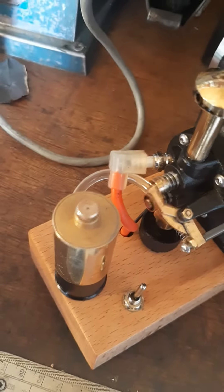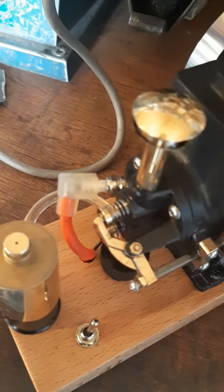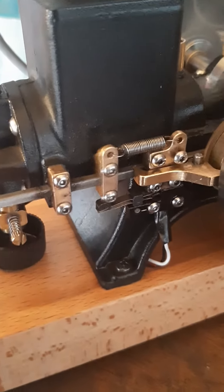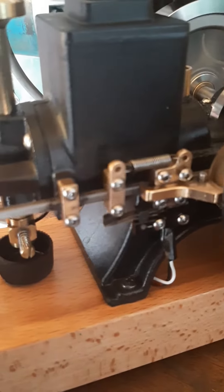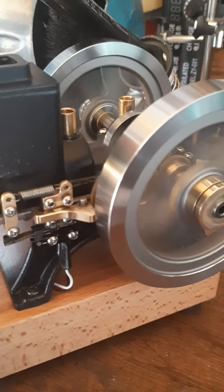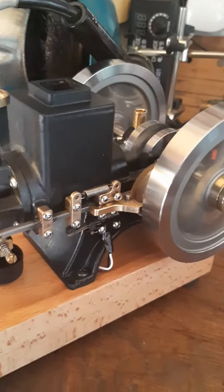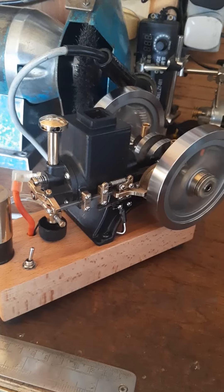So there we are — that hole there was enlarged very slightly, which was causing a vacuum; the plug cap was arcing past the porcelain; and these little microscopic points were in a tremendous mess. She's running again, but only for another five minutes before doing an electronic conversion with e-chain parts to make her run exactly as she should and be reliable.